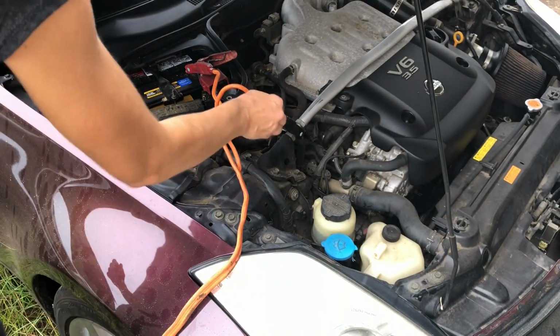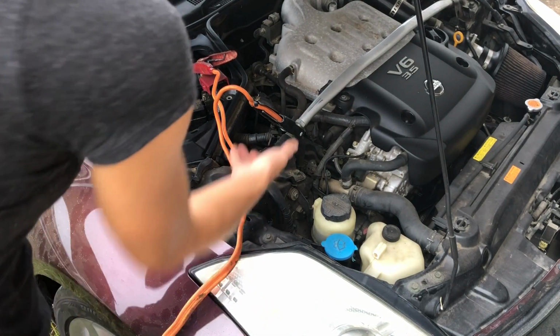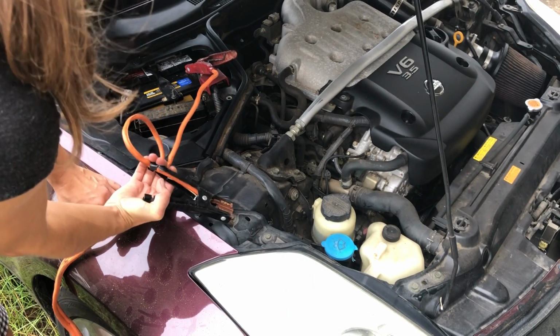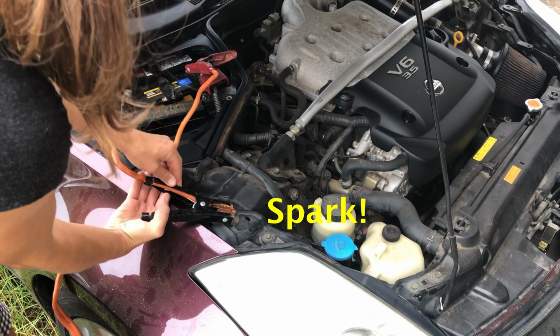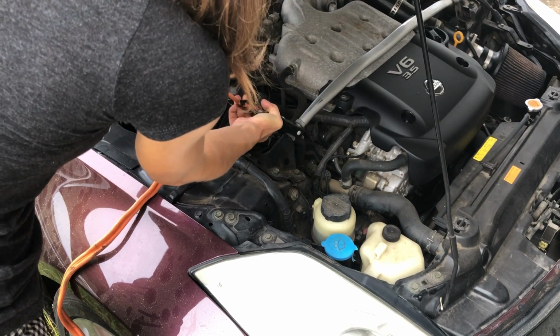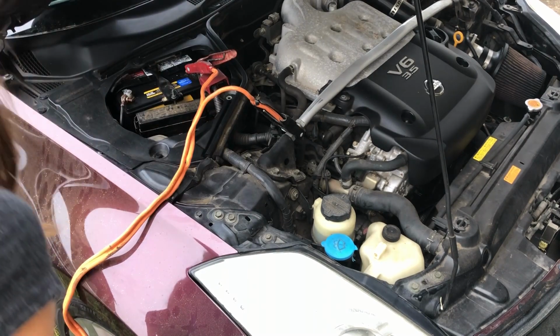That was an aluminum, nope, that's a stainless screw. Anywhere basically that's connected to your frame, we could also connect it to one of these bolts right here, just as long as you ground it to something that is not, well, that bolt's too small, but just make sure that you ground it to something on the vehicle's frame that is not actually connected to the battery.